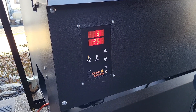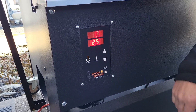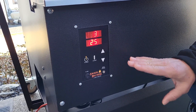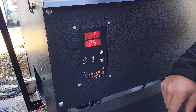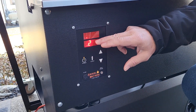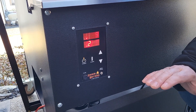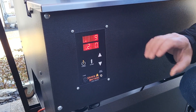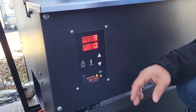The fuse is down here. It has a lot of programmable features that you can do through a series of buttons, but I wouldn't recommend messing with that unless you're talking to somebody at Smokin' Brothers — don't mess with the preset settings. One cool thing about this is it has a cool smoke mode. You can press and hold the power button for five seconds, and it'll come up on the screen as 'cool cook,' which basically just turns the fan on and nothing else. So you can use a smoke tube, put that in the grill, and the fan will blow the smoke around, and you can smoke cheeses and things like that.